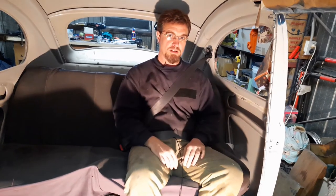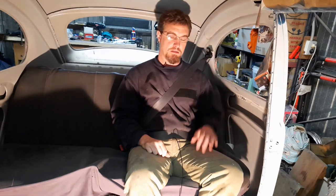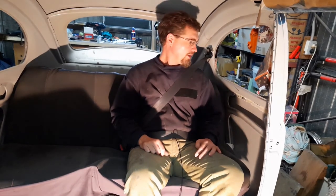So what I do is drill. I've got a couple of brad bits, spot weld drill bits, 6mm and 8mm, and I just use them to drill into the plate a couple of mil. And then I also just get my little Bunsen torch, and I just hold that on it until you can see the heat spreading, and I find that that just helps get enough heat into the thicker material so that the welding is actually going to penetrate and therefore bond the two bits together. So yeah, just a quick tech tip there.